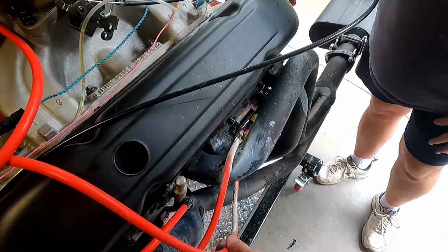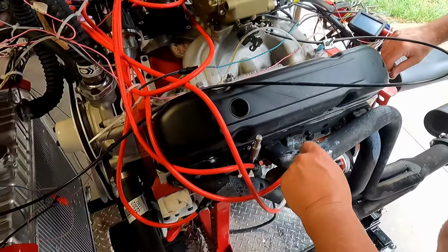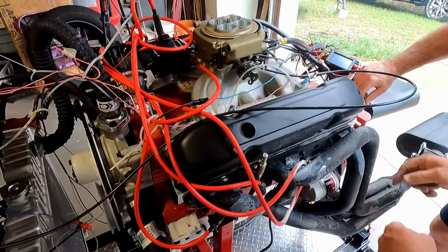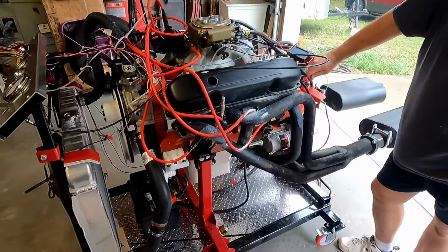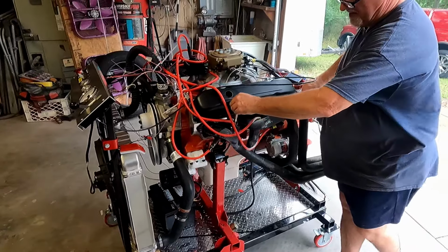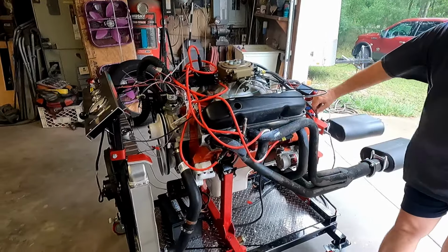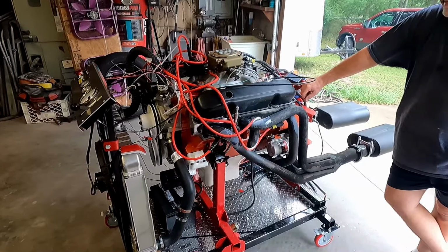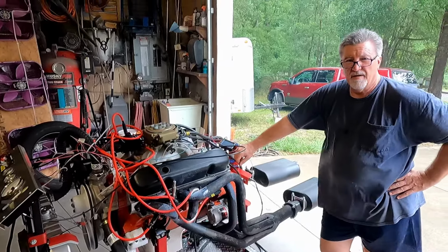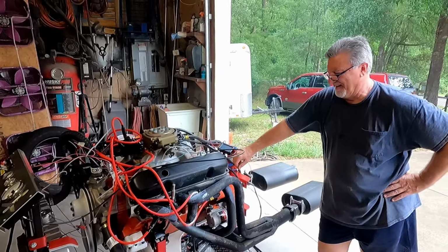It cooked it. Yeah, you need one that's that braided asbestos that far on the end. I've seen them before too. Yeah, I have too. They're made for headers. These aren't. And maybe I should wrap the headers in some of that. Yeah, Teflon. You probably could. I don't find that very attractive. Neither do I, but I don't like flaming spark plug wires.